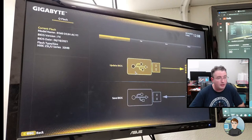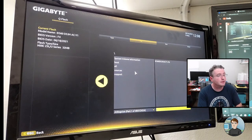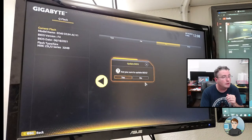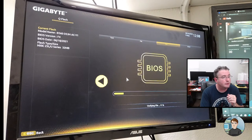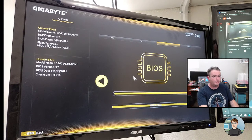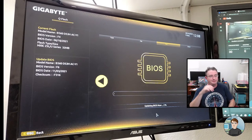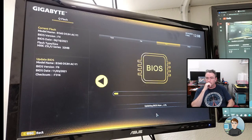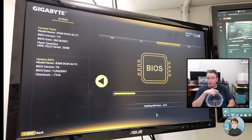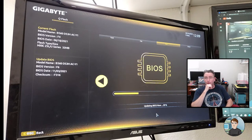So F8, we're gonna update the BIOS, and we're gonna point it at the BIOS file and go. Are you sure you want to update the BIOS? Yes. Let's see what happens. It's not complaining. I think it's going to be okay. Press to start. Sure, why not? There we go. So if this didn't work, what I would do is go to the iBuyPower website, their support section, and look for a BIOS update for this particular computer.